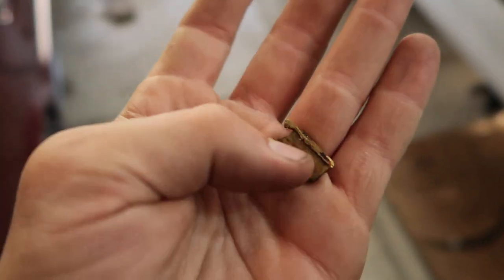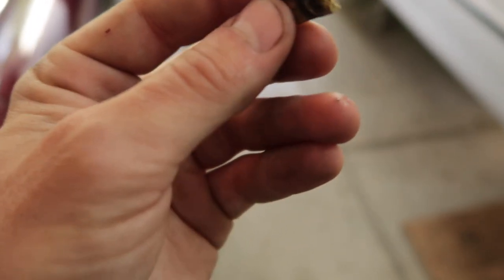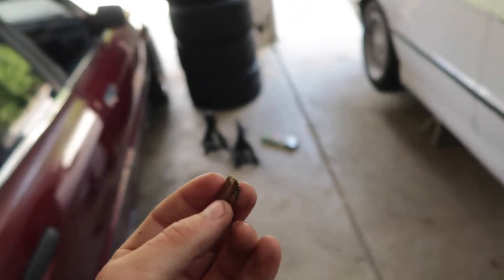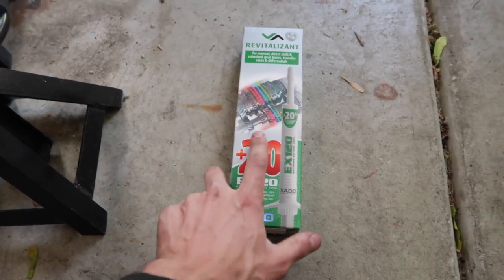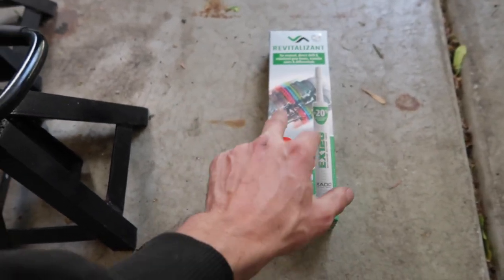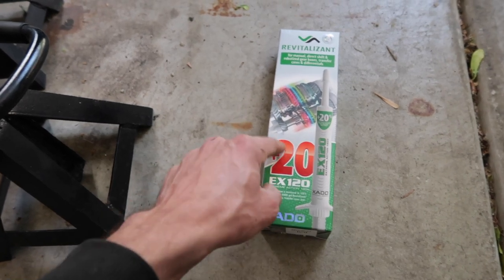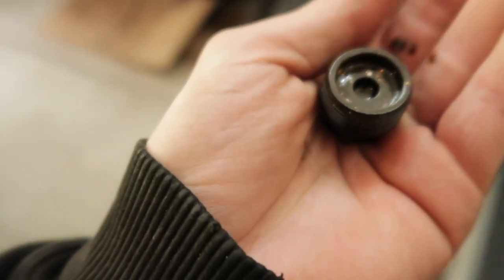So I knew third and fourth had issues. My guess is that this is a synchronizer — I obviously don't think this is part of the main gearing system. This probably explains the iffy gear shifting and could explain the noise too. Clearly this transmission is critically damaged. The piece has a bronze-ish gold look, and I believe that is a synchronizer because I'm pretty sure these cars have brass synchronizers — that's what I meant, brass, not bronze. So I believe that's all brass.